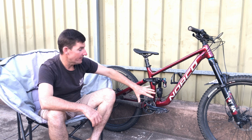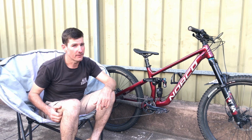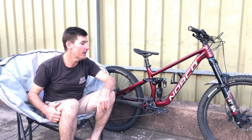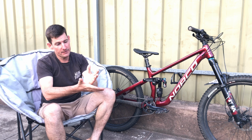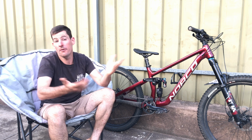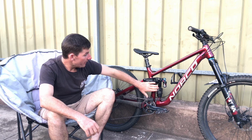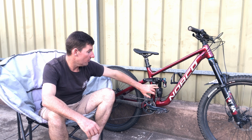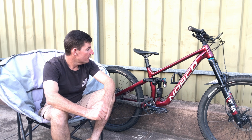19 mil is where I ran it today, and as you see on that video, it's hauling. It's hauling. I'm not touching the bottom anywhere. I'm not getting stood up anywhere. I'm just sitting in and just surfing. I'm riding the pedals. So 19 millimeters of sag, that's closer. You're getting down to 34, 35% sag there.